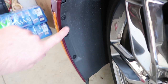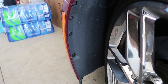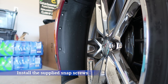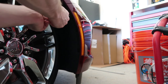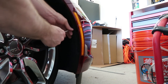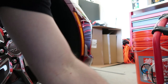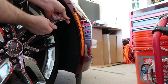With the wheel turned, you're going to see in here that there are three screws. This is where your T15 Torx screwdriver is going to come in handy. We're going to remove all three screws on both sides of the vehicle. You can see I'm doing this in a pretty confined space. If you do this over the winter time — when a lot of us do little projects on our cars — you can keep your car where it's at. Don't worry about trying to get it out. I've only got about three feet of space right here. It's just a matter of turning the wheels and being able to get in there.